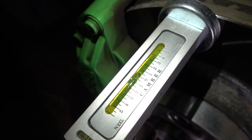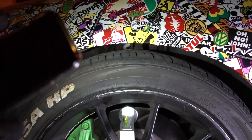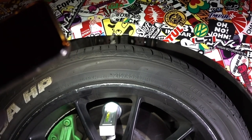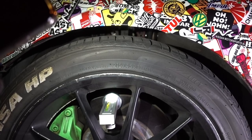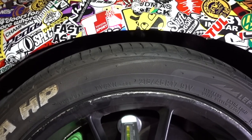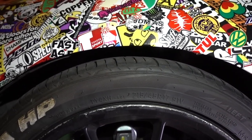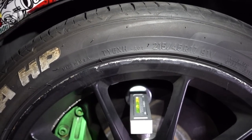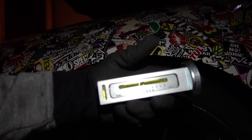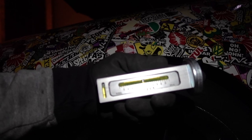Pushing it in — they're moving just a little bit. I got to check it and see where we are. I pushed the camber to the outside, and I think I just need to push it a little bit more and the front camber should be ready. Before it was two and a half degrees of negative camber, now it's almost one — we went down a significant amount. Now my tires are not going to wear out on the inside as much, thanks to this tool. That's how I do the camber adjustments now that I have coilovers. I'll keep doing it with this tool because that's a good way to save some money. Links will be in the description for the tool and everything I used in this episode. I hope you liked it — thanks for watching, don't forget to subscribe, and see you in the next one.